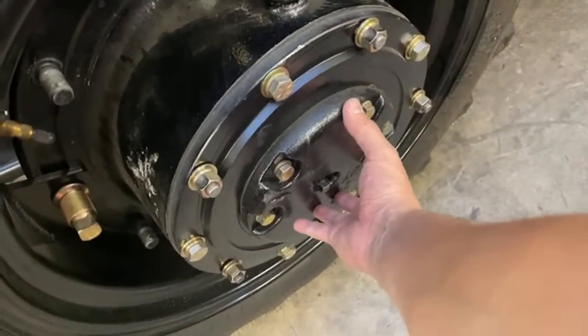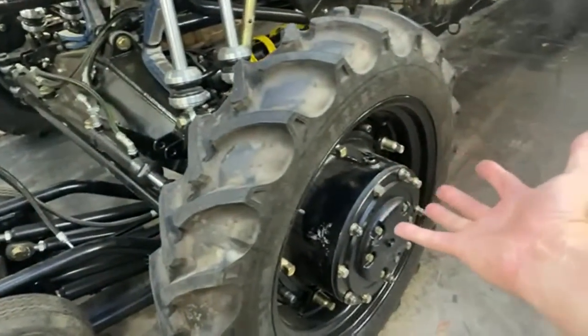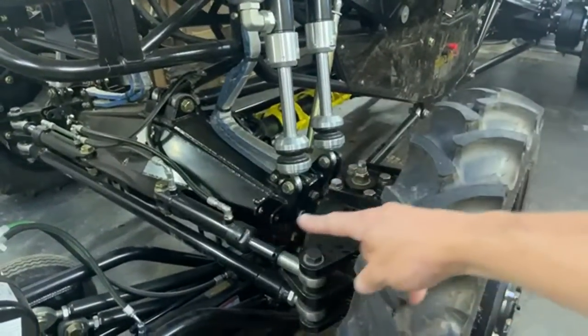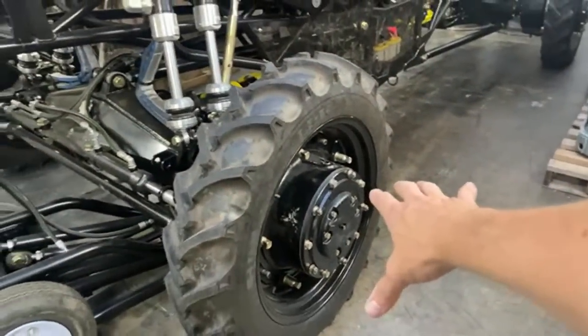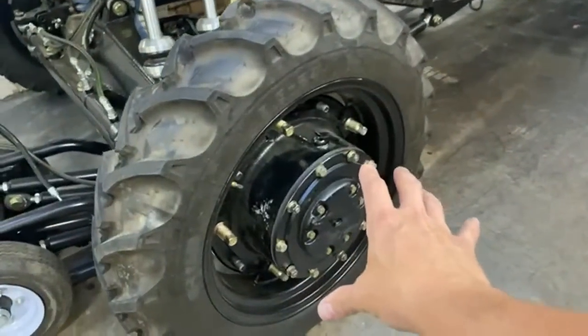In there's a load of gears, and it reduces the drive. So it's roughly a 3-to-1, I think, reduction. Some more professionals on there will probably know. So for every 3 revolutions of the shaft in there, the wheel's only going to turn once. So it takes all the torque, all that abuse away from the whole rest of the drivetrain. Before monster trucks had planetaries, I used to blow diffs, transmissions, shafts, everything. But these planetaries make it a lot stronger.